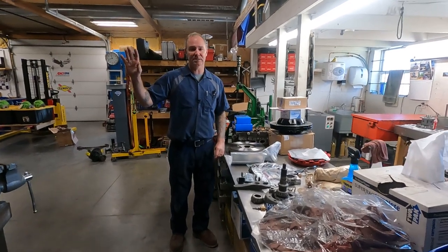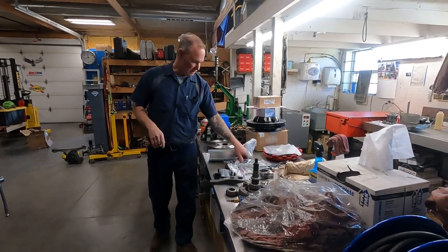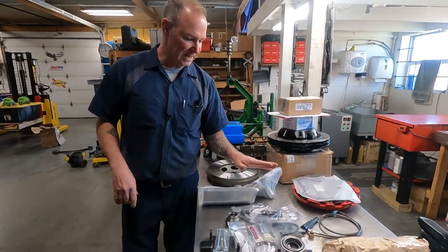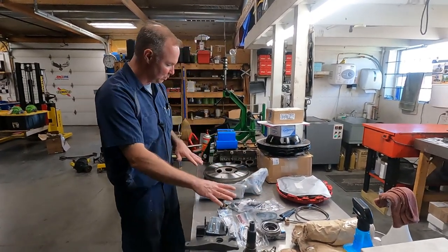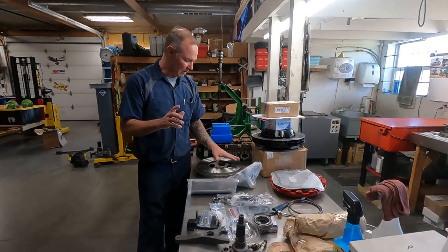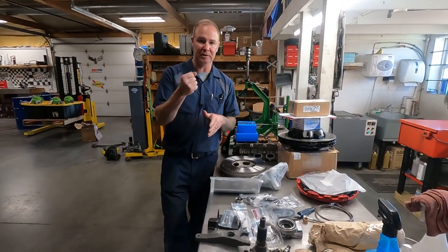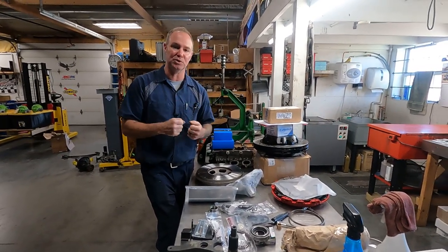We have never been into this transmission, clutch, and flywheel, so we've got a whole slew of upgrades here. Z1 Motorsports sells a new slave cylinder kit which is allowed for T3. While I'm in there I'm going to go ahead and change the rear main seal, get a new throwout bearing and a whole new setup. We're also allowed to go away from the dual mass flywheel, so I'm going to a one-piece flywheel and an upgraded clutch. The dual mass gives you a little in-between delay when you shift, so you don't get as crisp of a hit.